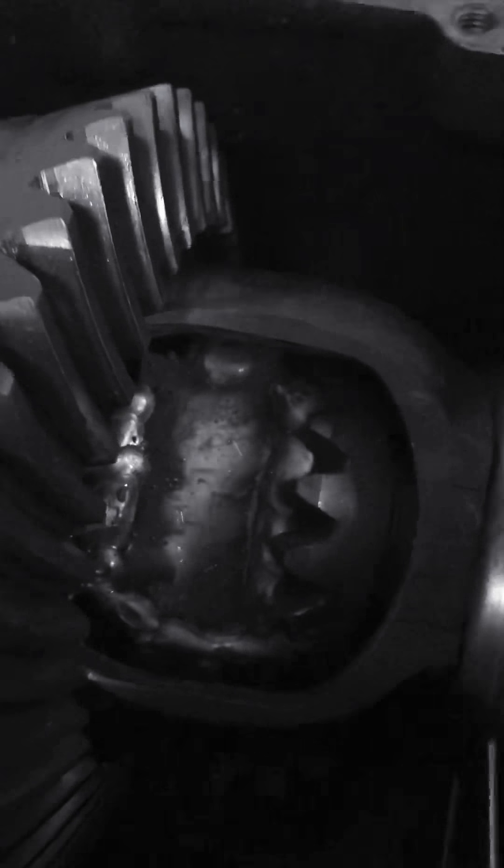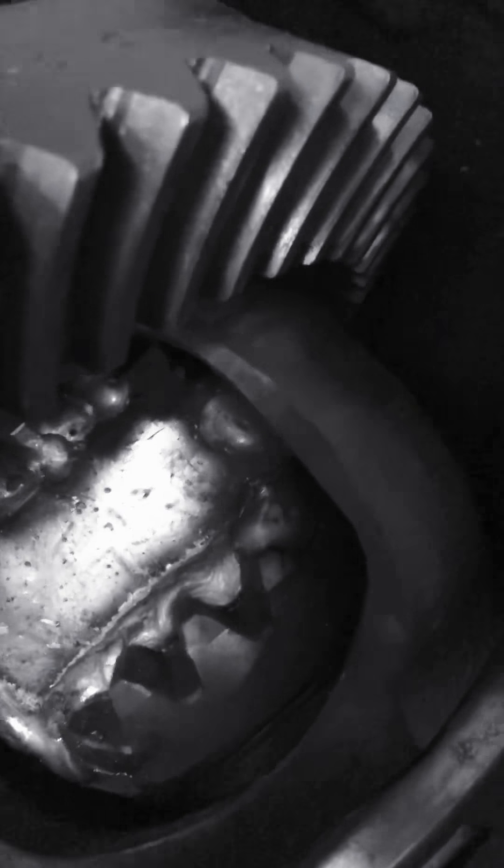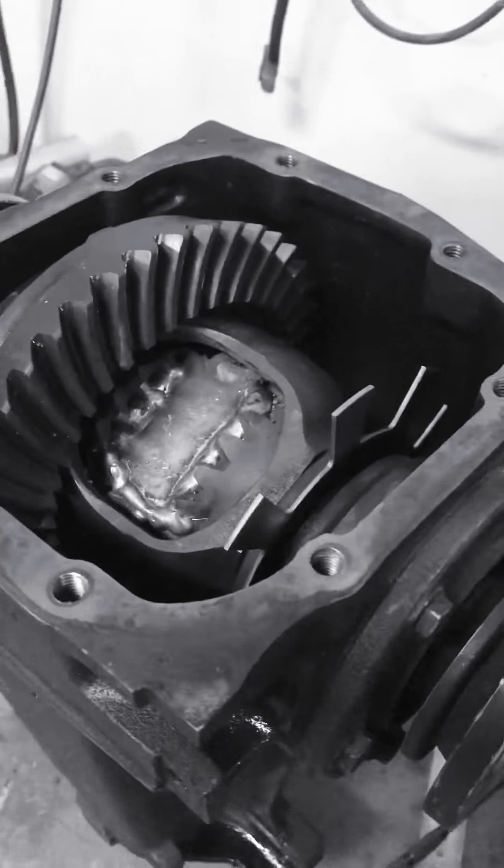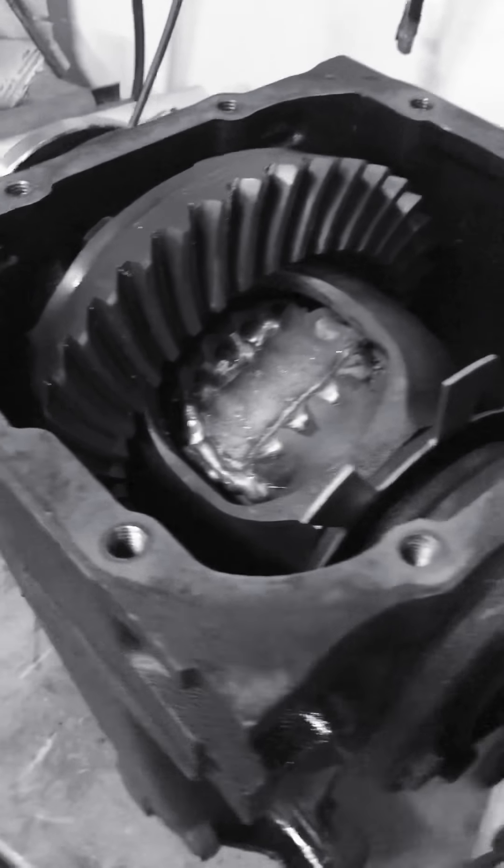Just finished welding it up. It's not a pretty job — quick and easy. Full power on the welder, weld all four corners and join as much of the planetary gears as you can with each weld. Weld right into the gaps and try to bond as much as you can — that should hold together. There you go, hope it helps. That's an E36 diff welded and ready for some drift.